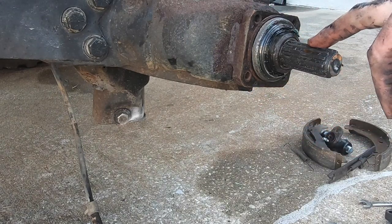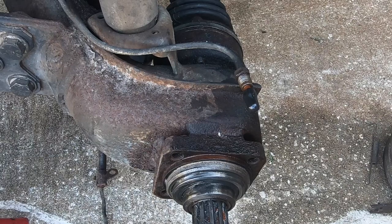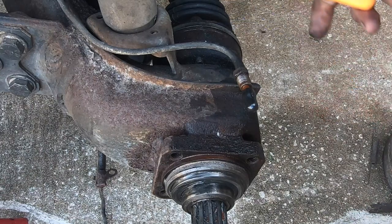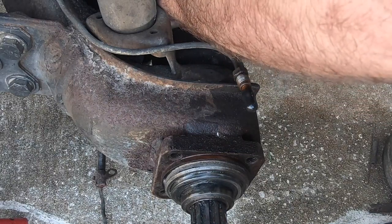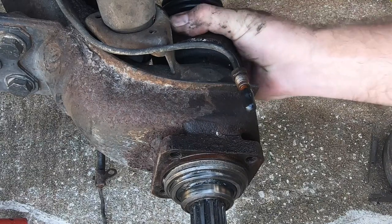In order to replace what actually broke, all we need to do is remove the CV axle. We should be able to slide it out, slide the new one in, make sure our spacers are correct. Then we can go ahead and put the drum back on after we finish all this up. For this next part, you don't really need to have the backing plate off and the brakes apart and all that jazz. We're going to pull the CV axle off so we can get the stub axle out of here and get that replaced. Now I took a pick and I cleaned out all of the bolts really good, sprayed it with brake clean, and then blew it out with a compressor. Most of the time do this by hand — don't use an impact — but that's one of those do as I say, not as I do.